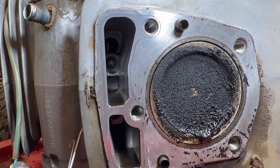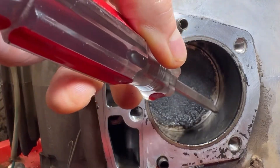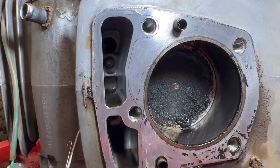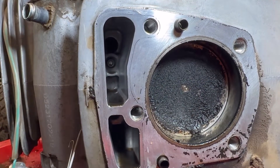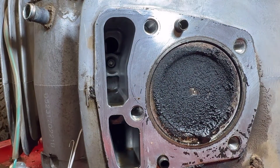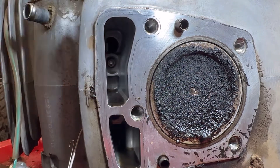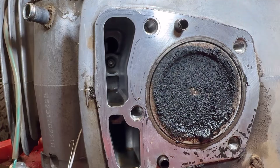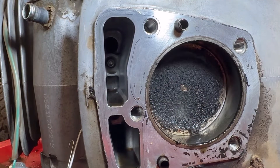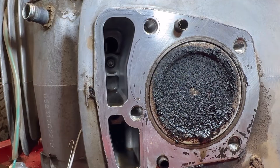Because if you clean it while it's at the bottom of the stroke, all this stuff is going to get in your bore, and then when you bring it back up, it's just going to pull that stuff down around the edges of the piston and you won't be able to clean it. So what we're going to do, we're going to bring it all the way up. Look — it actually protrudes out just a touch. So we're going to clean it right at the very top, and then pull it back down to get any extra gunk.